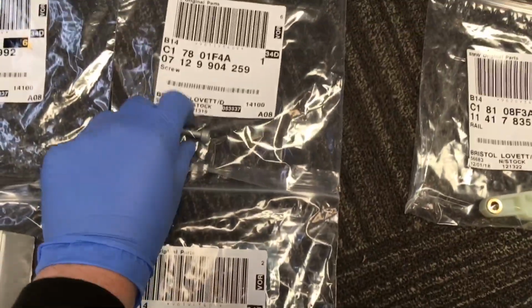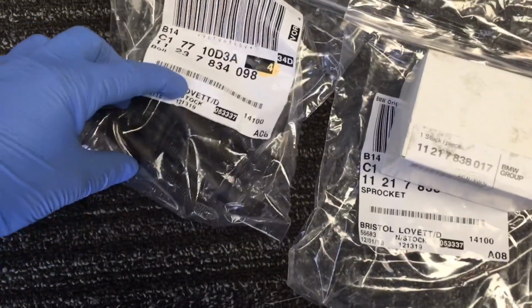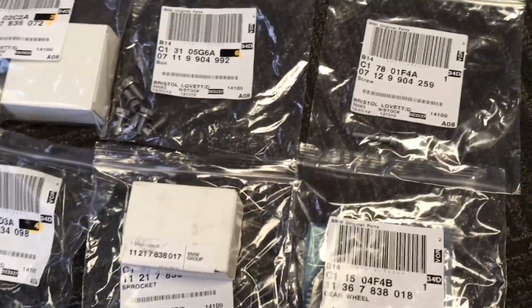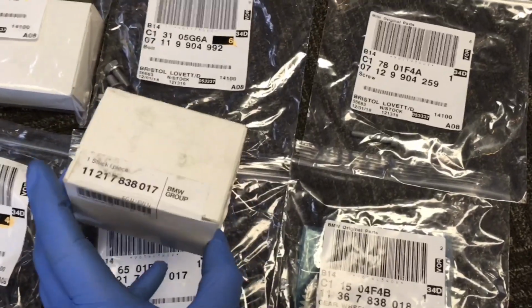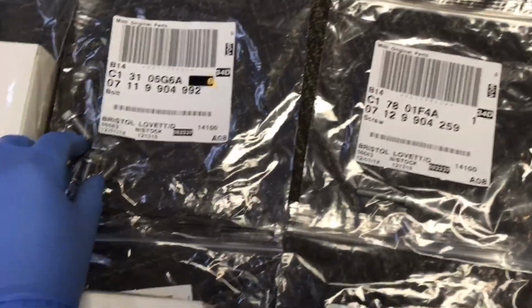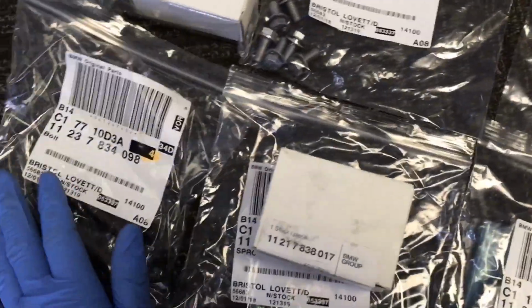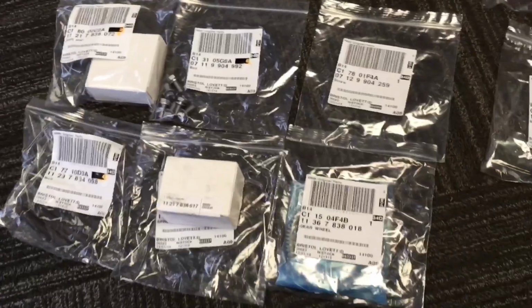So with that, there's a few items. You need a center bolt for the sprocket, you need the vibration damper stretch bolts, which you have to take off to release the timing case, behind the timing case, which is how you release this gear wheel. Got some new bolts for the belt driven section that bolts through the vibration damper, and then we've got a front crankshaft oil seal which you need to replace as well.